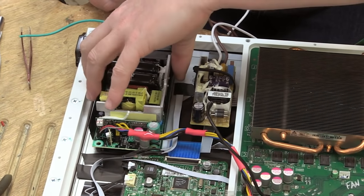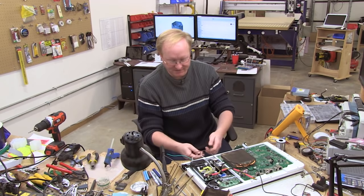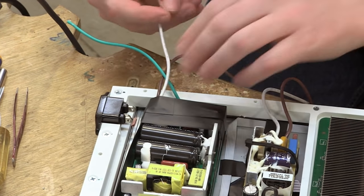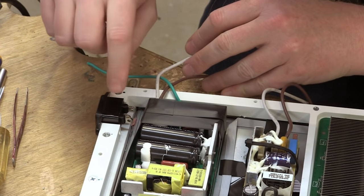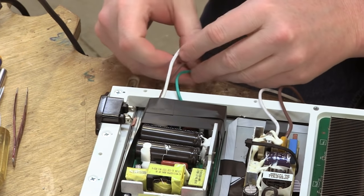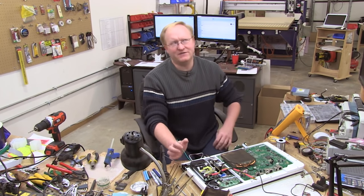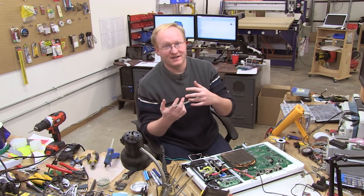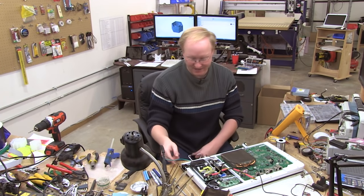I'm going to tie the AC lines together — tying the lines together is just the same as plugging them into the same power strip. I'm using brown for live and white for neutral since I didn't have any thick black wire, and this plug is labeled neutral, live, and ground, so it's pretty obvious where to hook everything. The Xbox One doesn't have a ground prong on it, but I'm going to add it anyway because you should. And if you think about it, even if it doesn't have a ground prong, if your TV or other peripheral does, it would get connected to ground because the HDMI or whatever would connect to the TV and that would go to ground.